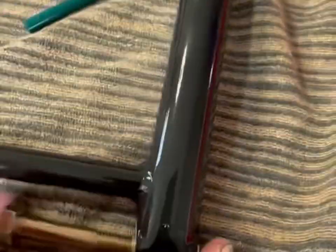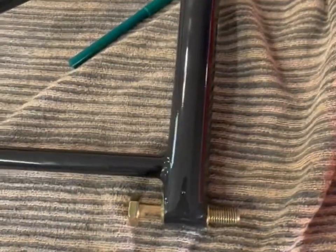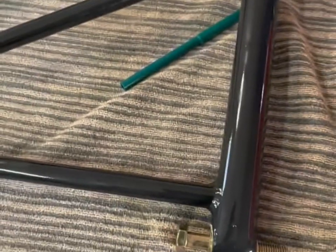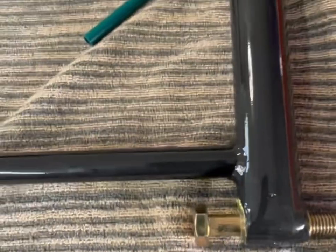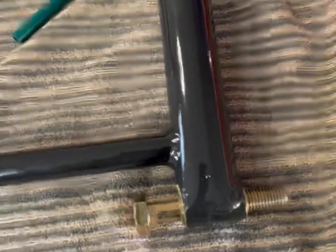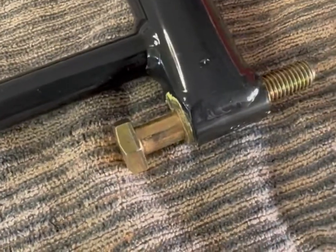Because there's a huge area there, when the bolt goes in it actually clamps the bush tight so that the bush doesn't turn around the bolt. The bolt, between the two lugs, tightens the bush so it sits there firmly — not turning — but the whole outer part of the strut just turns around the bush. That's quite cool because it'll take much longer to wear, and the bolt won't get worn either since it just sits there holding the bush in place.